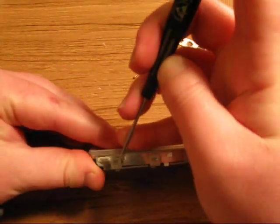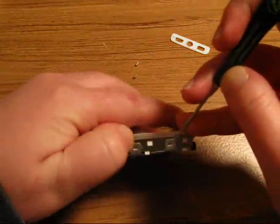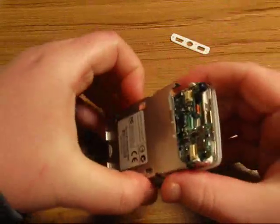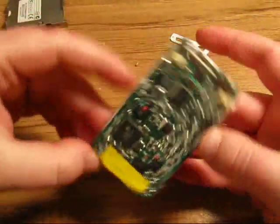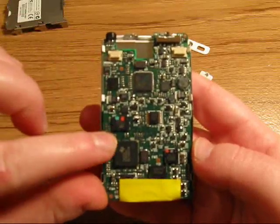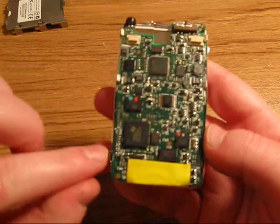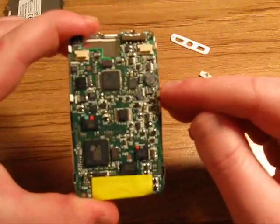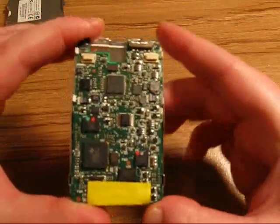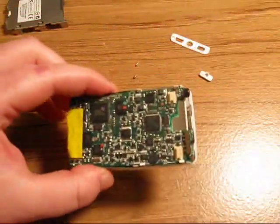I need to pop off the back metal casing. Now you'll see that the motherboard is connected and held on by six tabs — the top four are plastic and the bottom two are metal. You'll need to gently pull those back in order to release the motherboard.